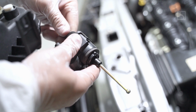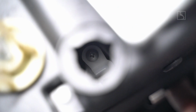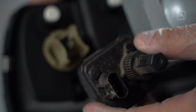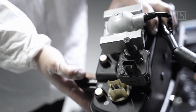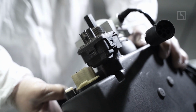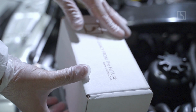Quick tip: to correctly insert the actuator rod, first rotate it to extend the rod, then insert into the headlight slot, and rotate backward to retract the rod until the actuator body gets very close to its installed position. Once there, push and spin hard against the metal cap and the headlight plastic. Once it gets in, the approximate 2 to 3 mm clearance between the aluminum cap and the leveling actuator will be re-established.